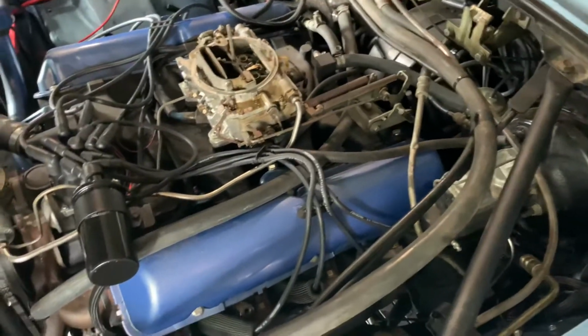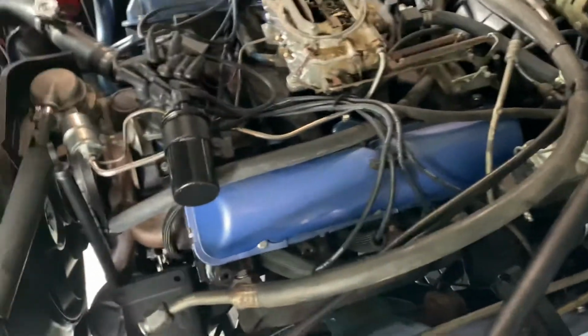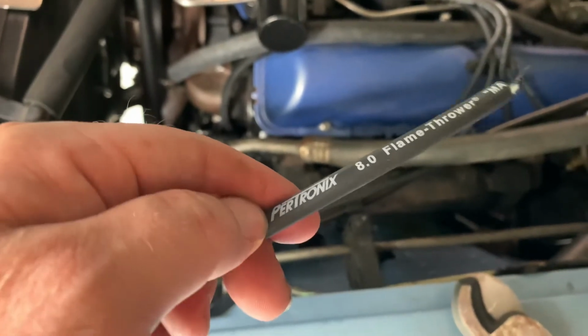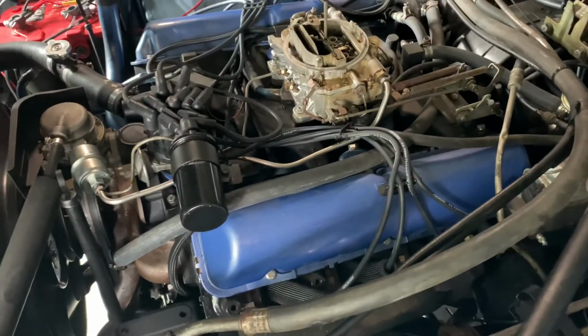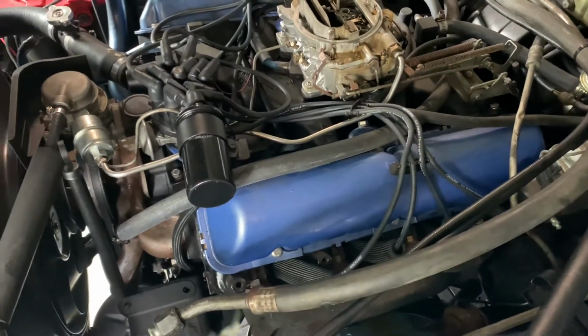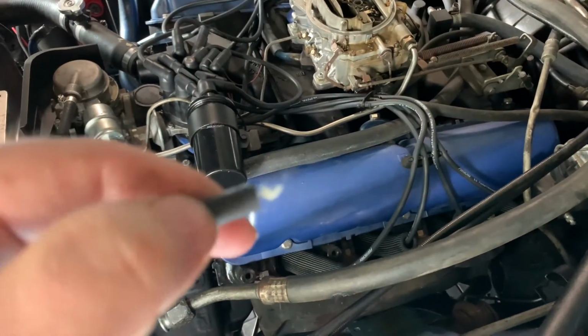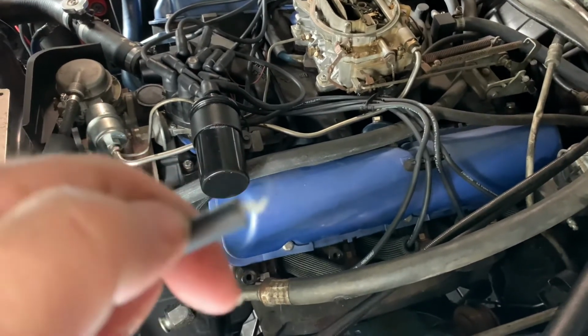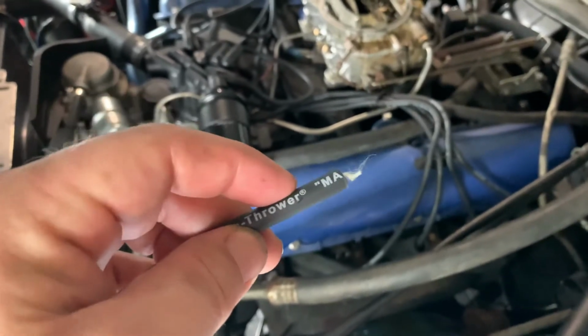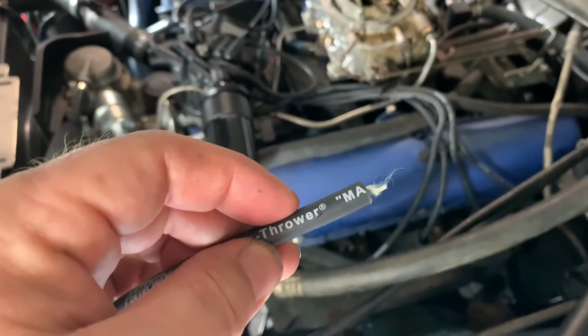And then I would come back to the back of the car, and I would use my electrical tape and tape off, let's say it was going to be right up to where that P's at. I would do a tape line. I would take the cutters, cut it, and then go into the tool that I left over there, spin it with the razor blade, cut the end off, take the pliers, pull that little bit of sheathing or insulation off, and then fold that flap over, which is important. Right? That's the most important thing. Make sure it's set in there right. I would double check it, especially the first few times I was doing it.